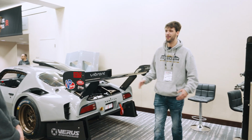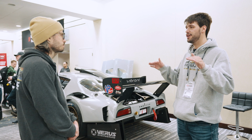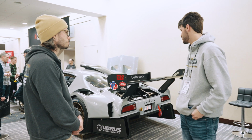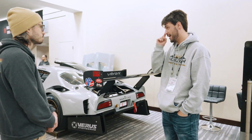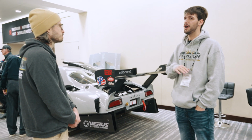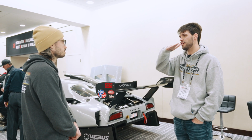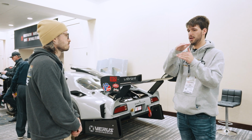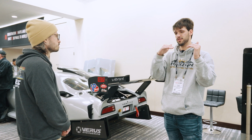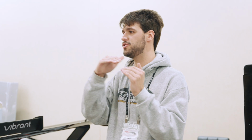but that's probably not where you want to actually go up on it usually, because if you look at the Mercedes GT3 car, it's got stages like this, not the other way around. So generally, I was just looking at a lot of Porsches too. I was like, this would work. And then because we have a flat floor, before, our diffuser was modular, and it was not a constant angle. It kind of had a dip in the middle. And one of the things I was thinking was, we've got to get that out, right? Because you guys were talking about how you just generally want a constant angle.